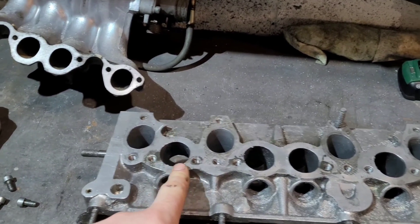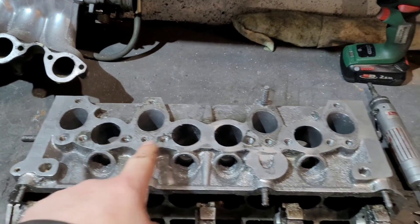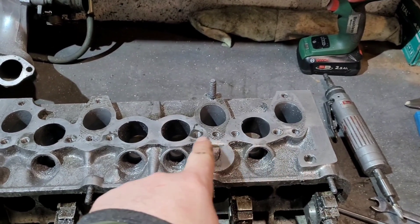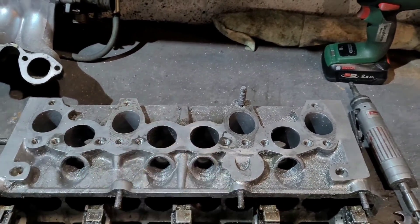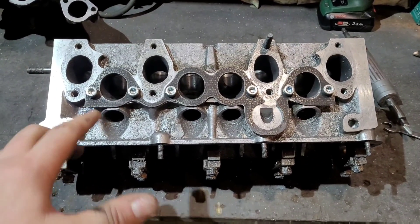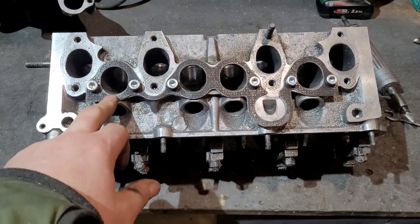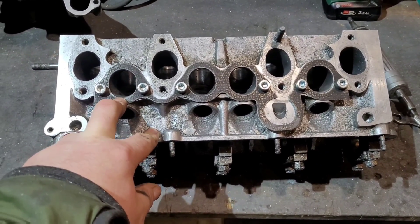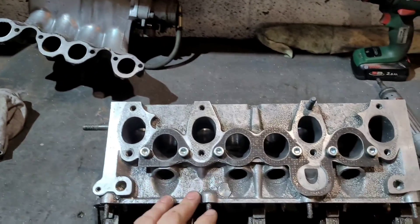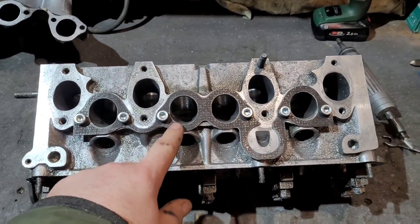What we need to do is get a new inlet manifold gasket and fit it on the car - we'll put that on here and get some short bolts and tighten the gasket down to the head itself. Said gasket is on. This is the gasket you're going to use to fit on the car because it's going to be specific to this head and that manifold. When doing these down, just nip them - don't distort the gasket.